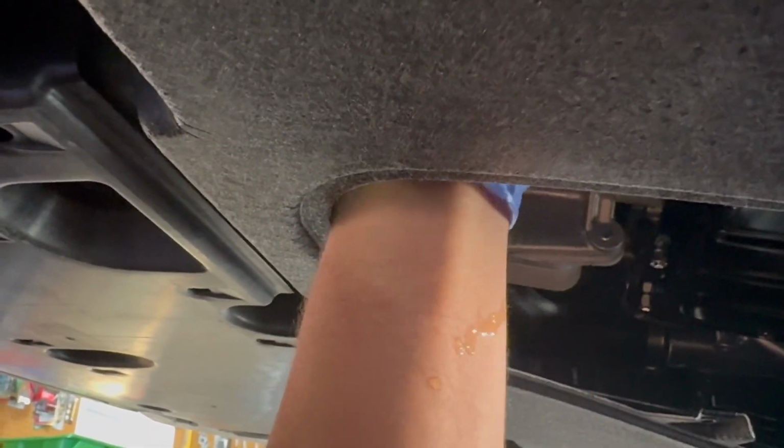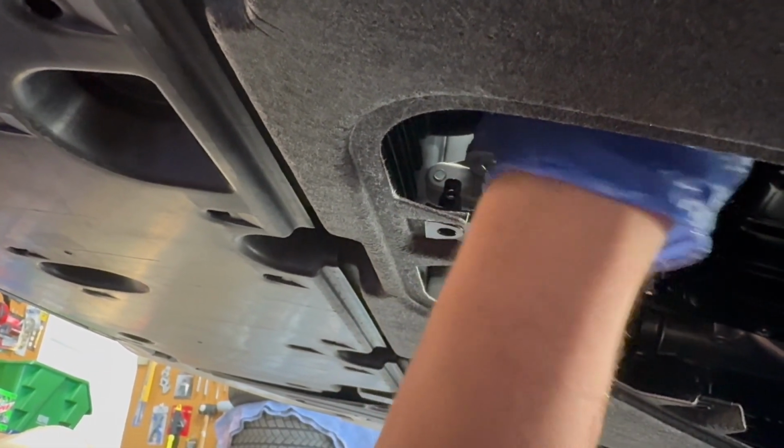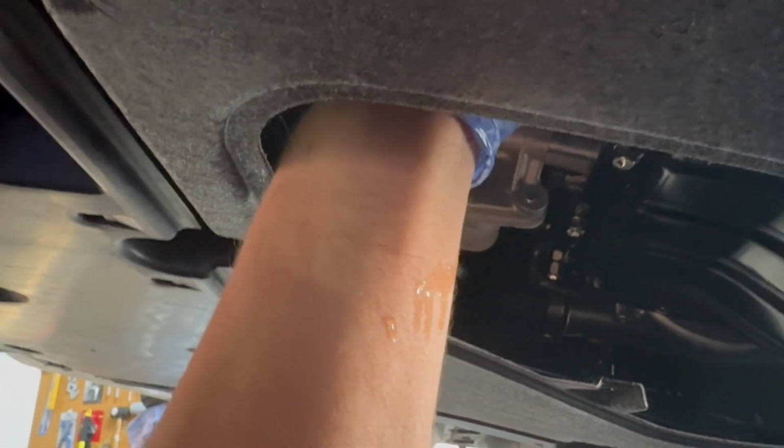And usually, I don't lose very much, and you didn't. It's pretty easy to get it started, threading it. When you pre-fill it, I've checked and actually compared the difference, and I build oil pressure much quicker with this. It is true, your engine, you drove it over here, so there's still an oil film on all the parts, because it hasn't been sitting very long. But it's never going to hurt to pre-fill it.